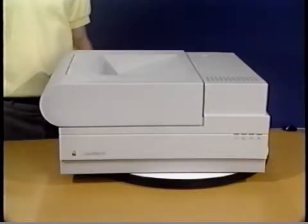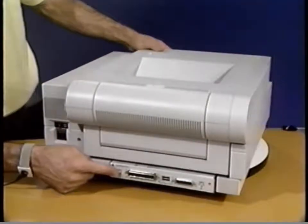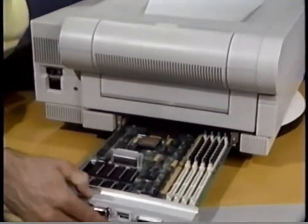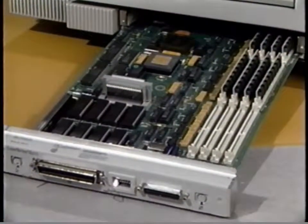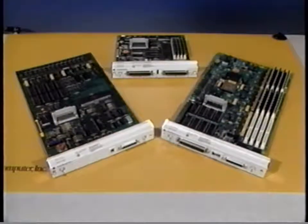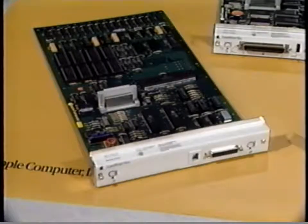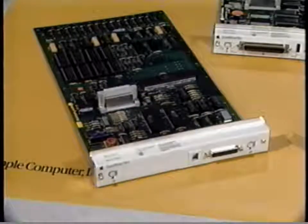Next, we'll locate the control system and its five major parts. The IO PCA is located at the bottom of the printer. It controls communications between the printer and external computers and generates the user test print. The LaserWriter 2 IO PCA contains the PostScript ROMs which convert PostScript commands sent from the computer into a bit image, which is then sent to the DC controller PCA. There are three types of IO PCA: the LaserWriter 2 SC, LaserWriter 2 NT, and LaserWriter 2 NTX.